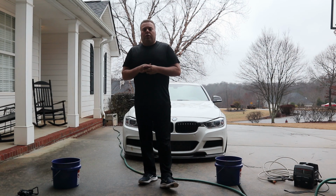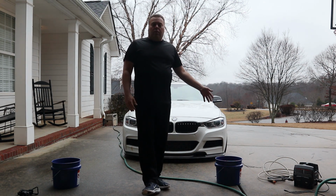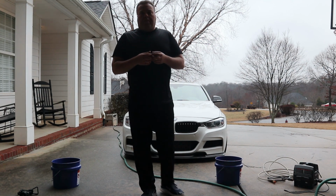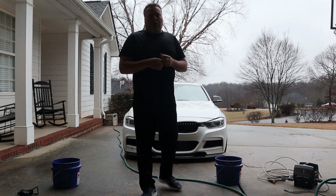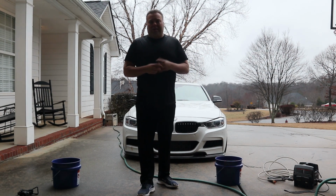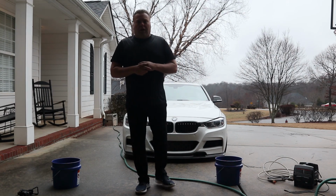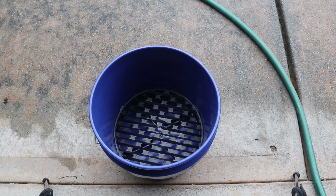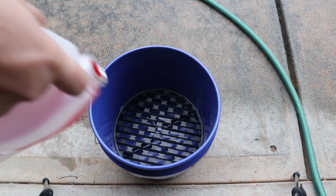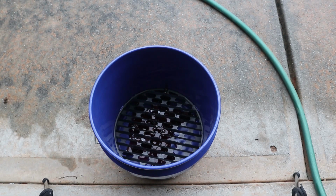Of this video, we're just going to show you how we prep everything just on the hood in the front area. I'm going to fill up this bucket with the Vehicle Boat Wash because you want to use a little bit more of a detergent type soap when you're trying to strip the car. You don't want to use a pH balanced car shampoo. It's not going to strip any of the wax or whatever sealant that you have there off. See, I was using a cheap bucket with a grit guard. It cost me like $6 or something like that. We'll put a liberal amount of Vehicle Boat Wash in there, then mix it up with the water.